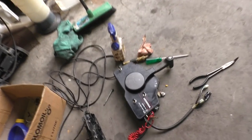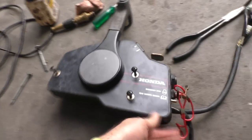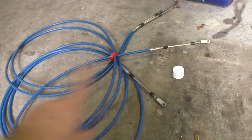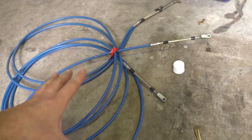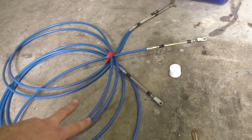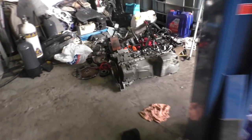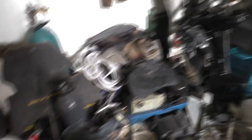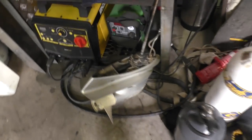My goal for the day is to open the control unit up, clean that out with some fresh water and lubricate it. I'm going to put the control cables on the air compressor and use that technique of pushing oil through to displace any water and make sure they don't seize up over time. Over here is the gearbox somewhere — what a mess.